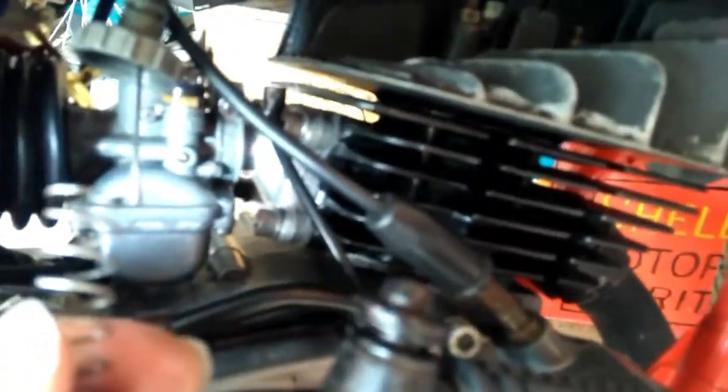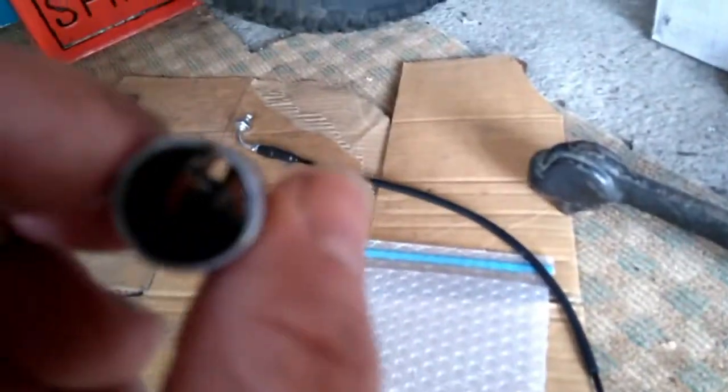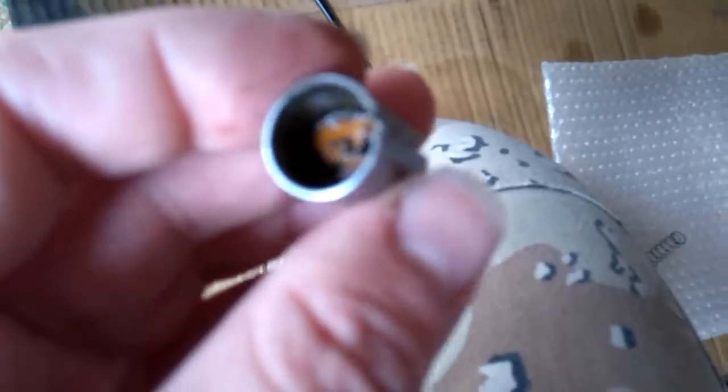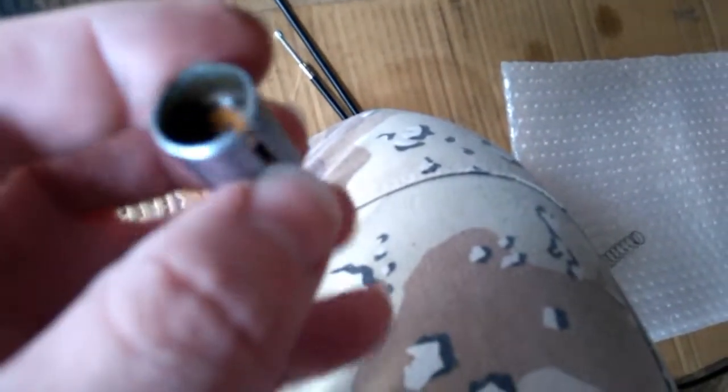The cable went down the slot there in this sort of order — the spring went on, the cable went through the spring, and then down here. It's looking pretty mucky actually. Just pressing the needle and out this pops. There's a little circlip on there and there are some grooves. The circlip is on the one that's second up. There are some grooves in there with a circlip on it — it's on the second one up. I have an idea that that contributes to some of the jetting, so we'll have to look into that.